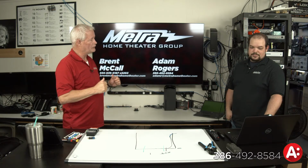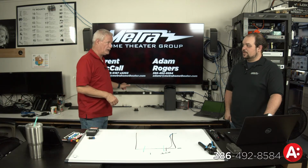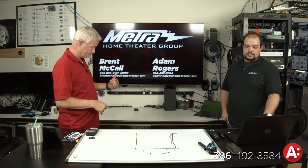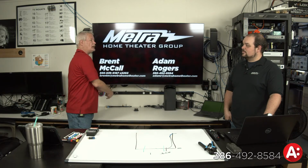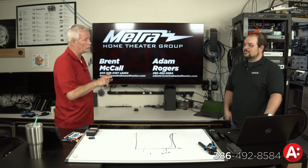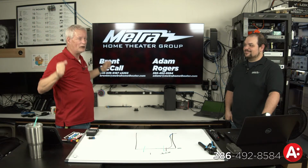However, the problem with that is cable boxes, satellite receivers, a lot of set-top boxes, when the TV goes off, hot plug is not there. Excuse me, hot plug is there, but EDID's not. So that periodic communication, who are you, what's your resolution, is gone. But the source, because it's still seeing hot plug, doesn't know to restart that. So it just turns on, it doesn't know what to do, how to do it, when to do it, or where to do it. You unplug the cable, you plug it back in, there's a fresh hot plug. It's like, oh, hey, there's a new display. Let's start all over. Hi, I am.